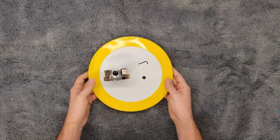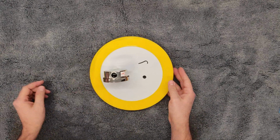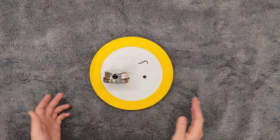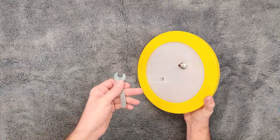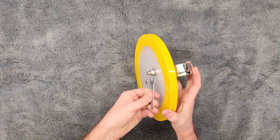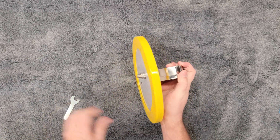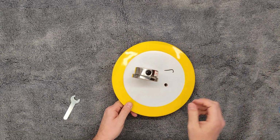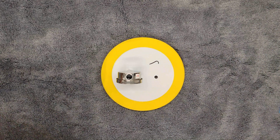But what we're doing, back to our orientation, the gauge needs to be facing 6 o'clock, and we want to have the face running horizontal across the face between the 9 and the 3 is our setup position here. There again, I will give you a wrench along with it, but we're going to get this finger tight. And then you may need just another quarter, half turn. That is more than enough. If this isn't easily rotating by hand, then it's plenty tight. So that's step 1.